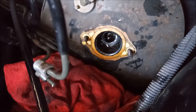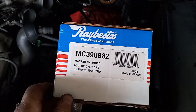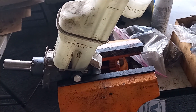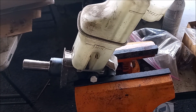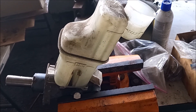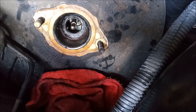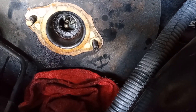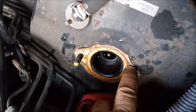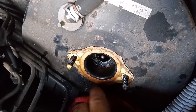Here's the entire master cylinder with the reservoir, and here's a view of the brake booster. It does look like there was some leakage back here. This is the replacement part I'm using — I'm gonna put a link in the video description. The replacement master cylinder comes without a reservoir, so I put the old master cylinder in a vise temporarily to disconnect the reservoir. Don't forget to install the rubber grommets on the bottom of the reservoir. Now we check out the opening of the brake booster, clean out any junk or dirt, and wipe it out. This piece on the outside is the gasket — it's very thin gasket material and the kit did not come with one, so we're just gonna reuse it.